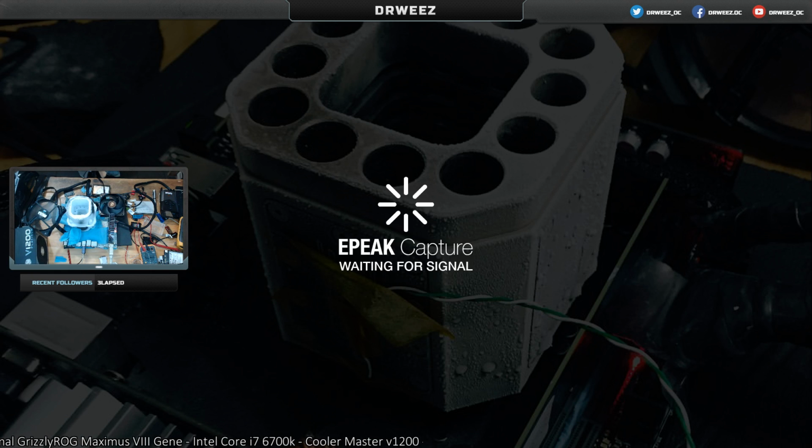Alright, so I'm not 100% sure if I'm actually going to improve on my board without really going through and having a look at the memory timings and that whole setup. The problem I have is the condensation issues. So going and trying to tighten up the timings too much now is really not going to do me any good, because of the moisture on the board already. So I'm going to go ahead and save this BIOS profile as a good starting point.